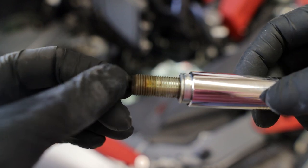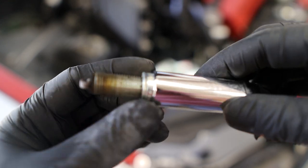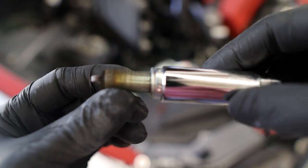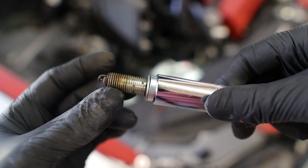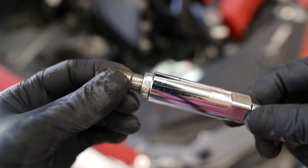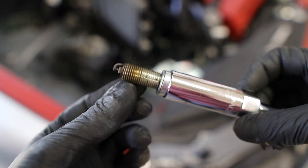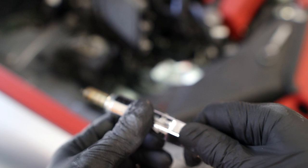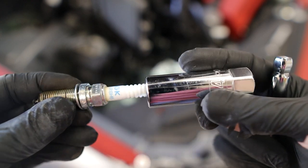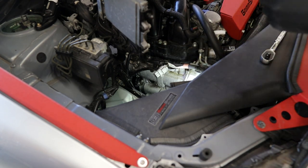So that looks quite a bit more normal. Just a little bit of wear and tear, not any oil leaking. So it looks like it's just that front one, which is good. So now that we have these out, might as well install the new ones on this side. Actually, yeah, let's just do that. So as you guys can see, the top of the plug is being held in by this socket, by that rubber. So awesome. So in go the new plugs, and do the reverse order.